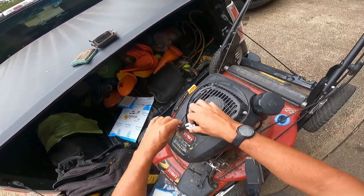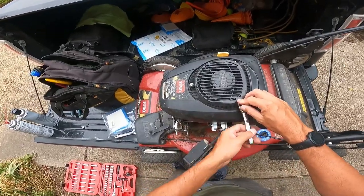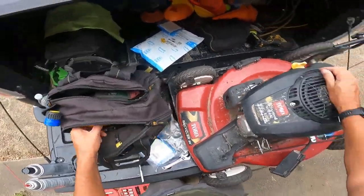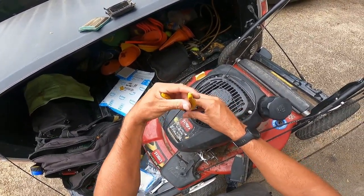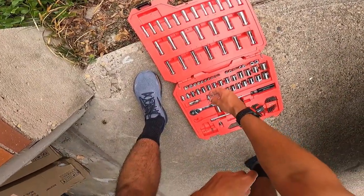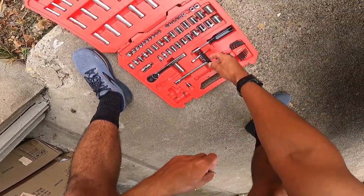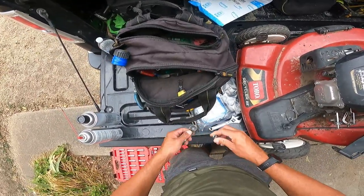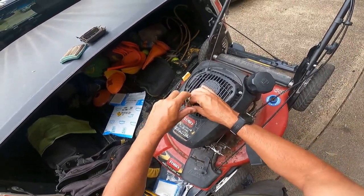I did not empty the gas, but I put a little clamp on the hose so it doesn't bleed right out. This may not even be how you take the shroud off - what I'm trying to do is take off the shroud. I need a deep socket 10 to spin it off. I don't have a deep socket 10, got a deep socket 12 but no 10, and no extension. Let's see if this works - yep, just need to spin it off like a screwdriver.